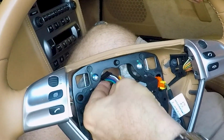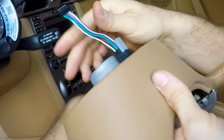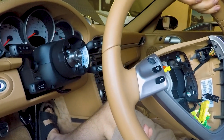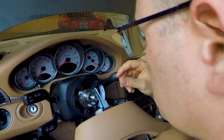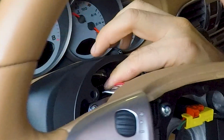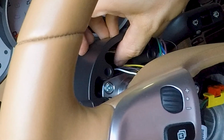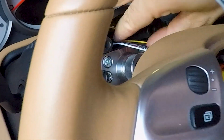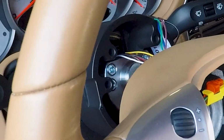Then make the wires gently go inside the slot and go close to the spacer with the steering wheel, and take your time to insert the other side of the two jumper wires in the black connector of the car. You need patience, and to take your time and to operate very gently, because the pins are hidden down there. You don't see them very well, and it's easy to miss a row and to unconnect the wires accidentally during the operation. So please take your time to do this part of the job.